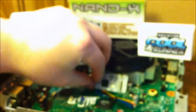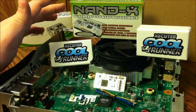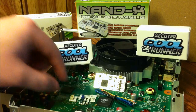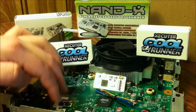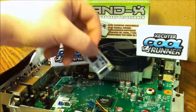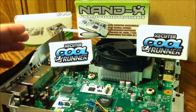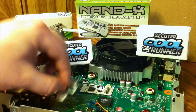We'll be using the NandX that has the v3 code on it to program the Cool Runner, and we'll be using it to read the NAND, which will connect to this as well. This goes in this area here — I'm just getting it close to show you where everything goes on the install. This right here goes right there — that's where this stuff will be installed on the console. I'll give you guys step-by-steps for this and take some pictures for a diagram, but first things first, we're going to go ahead and install our quick solder board.